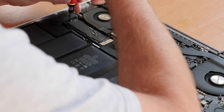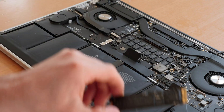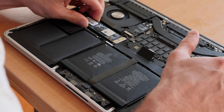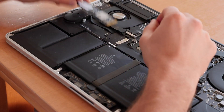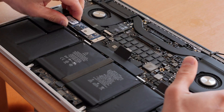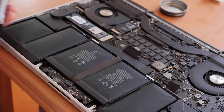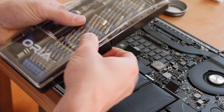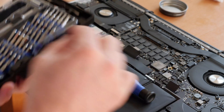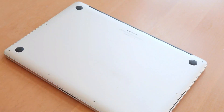After watching the video from start to finish, it was my turn. Theoretically, the whole thing is super simple — you take one screw out of the Mac, remove the hard drive, and slot in the new one. It came out pretty easy. But this is where things got a little bit tricky, because what OWC doesn't mention is that the hard drive is very, very hard to fit into that little space. I actually thought it was in there once, screwed it in, put the whole Mac back together, and started it up only to find out the drive wasn't in all the way. So I had to take the entire computer apart again. You can tell it's in all the way once the mounting screw is completely revealed — you basically need to shove it in for all your worth without damaging it. In the process, I also found out that the bit on my original screwdriver had stripped, so I switched to my new screwdriver for the rest of this.